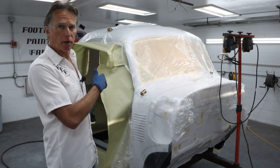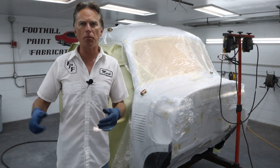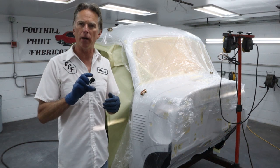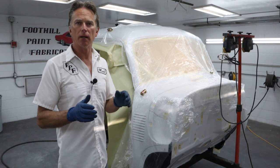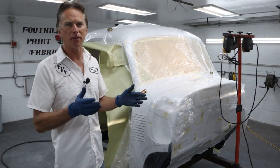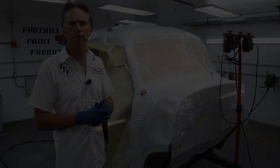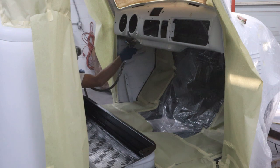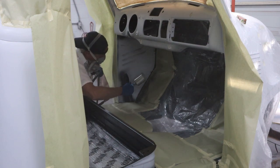I've got everything blown off and tacked off. It's looking really good on the inside, though a little dark for obvious reasons. I've got lights pointed through the paper and plastic to help illuminate it, plus my small light to check coverage while painting. The gun is loaded — the Starting Line gun is loaded with about half a pot so when I'm spraying up underneath I don't have to worry about it running back out of the breather hole. I'm going to get all the hard-to-reach spots first, then move on to the field. Let me grab the gun, my respirator, put my hat on — it's hard to show inside the cab, but I'll do the best I can. We'll get this base coat sprayed, let it dry, then mix up some clear and get this thing cleared.